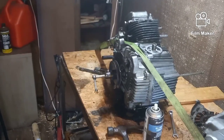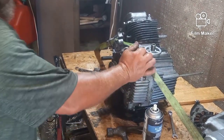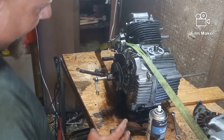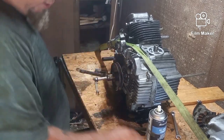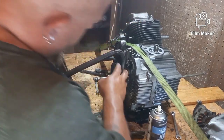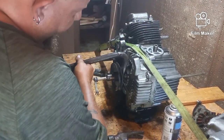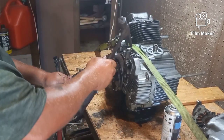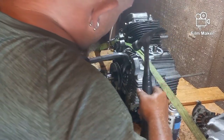Sorry. Okay, we had to go old school, like ancient here, like from the dark ages, because I heated this thing and quenched it 4 times. No good. I decided that more than likely I'm just gonna replace this pulley because it got bent up a little bit with this. So I have been beating on it now for 15 minutes. And you beat on it in one side, and then you turn it and beat on it in the other, and I've got penetrating oil in there. And finally, it's moving. It's coming off. So we're going to be replacing this pulley, that's all. Not a huge deal. I took the oil-filled release out so I wouldn't hit it. It's just plastic. And try not to hit your motor case, because then you'll really be screwed.